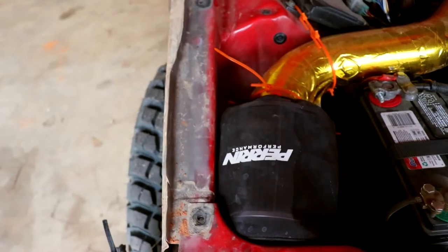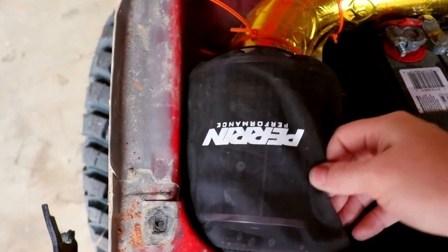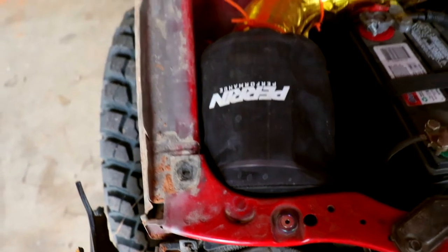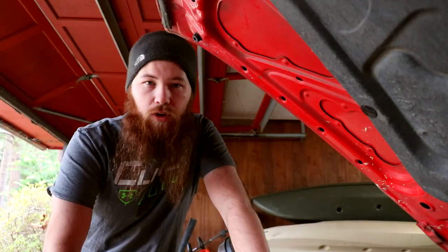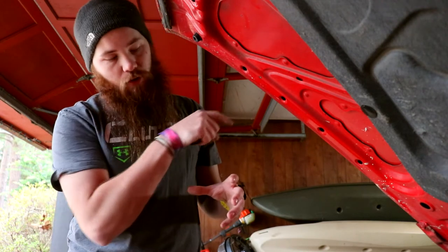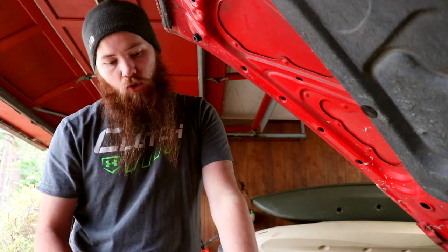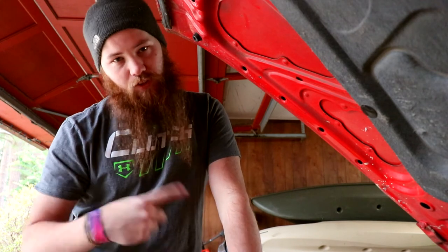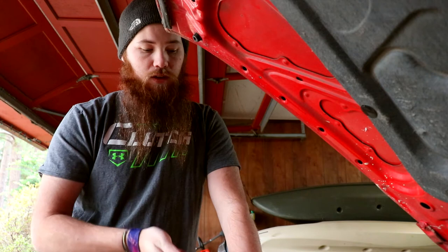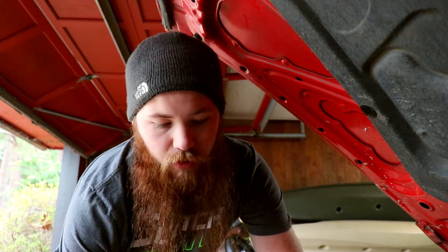For a rain setup, if I'm just driving normally, I'd like to bypass the snorkel and just run the filter like normal. This pre-filter keeps water and dust out and works pretty well — it was actually off an Element for a while. Whenever you're getting your snorkel set up, you can use what I'm doing: I bought a drop-in filter that goes into the snorkel like a sock and rolls over the edges, held on by the snorkel head. Or you can use your existing air box and route the snorkel into it, sealing it off from water. Anyway, a quick comprehensive review on this $26 eBay intake.